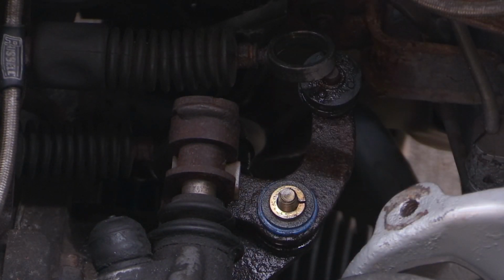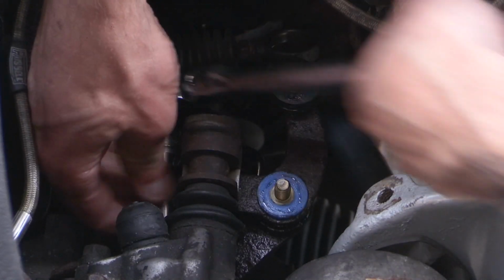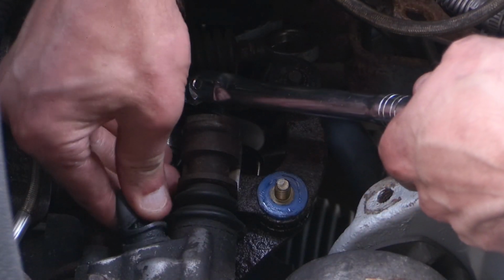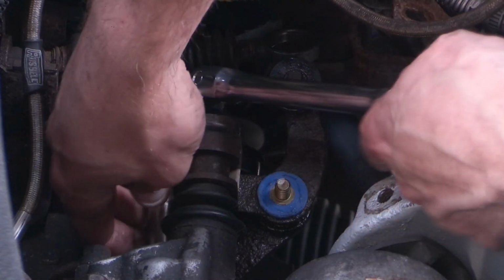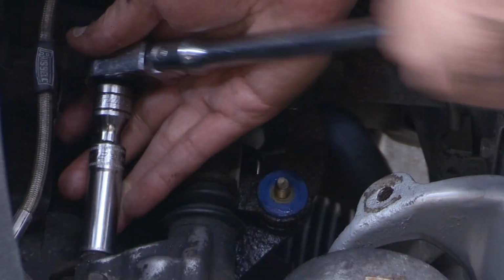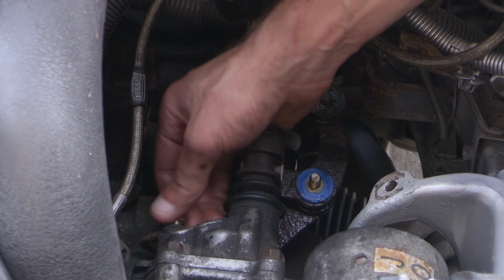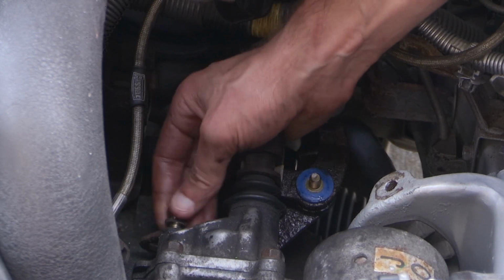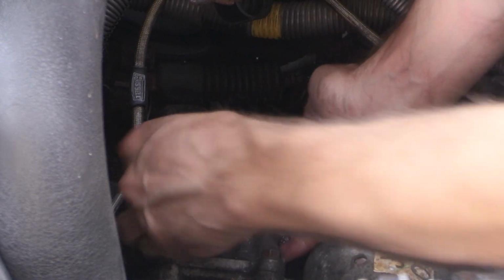Again, a bit hard to view, tough to see, but there are two bolts that hold this other shifter piece in place. You'll get a little better view of this arm once it's out of the car, and then you'll be able to see a bit more about where they're located, but you'll figure out where those two bolts are to remove this arm. Again, you don't have to do this part if you were just changing those shifter bushings and your old one just popped off. You should just be able to grease it up a little bit and slide your new one on. But we're going to dive into this arm a little bit and fix our sticky shifter issue here.